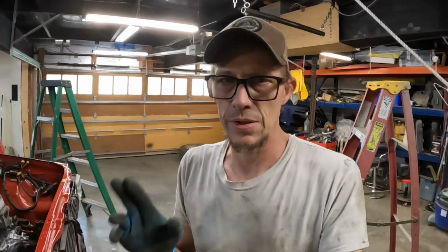And then I found some off-the-shelf rubber hoses that are a different Toyota, but they end up being right for this. They end up being a couple inches longer in the front, a couple inches longer in the back, and I don't know what my price is yet, but the online price was more like 15 or 20 bucks a piece versus 100 bucks for a set, which really isn't that bad. But at the same time, the stainless steel brake thing is cool, except for when you have a problem and no one's got one on the shelf. At least this way we can get a part that will probably be on the shelf, and if not on the shelf, it'll be like an overnight thing.